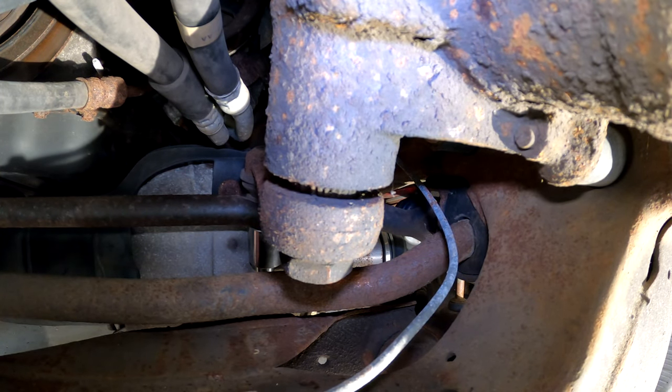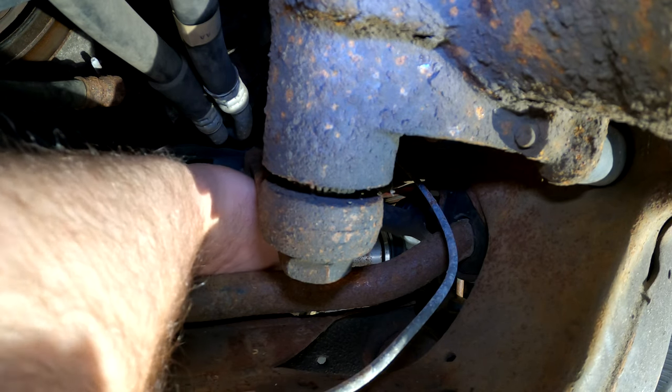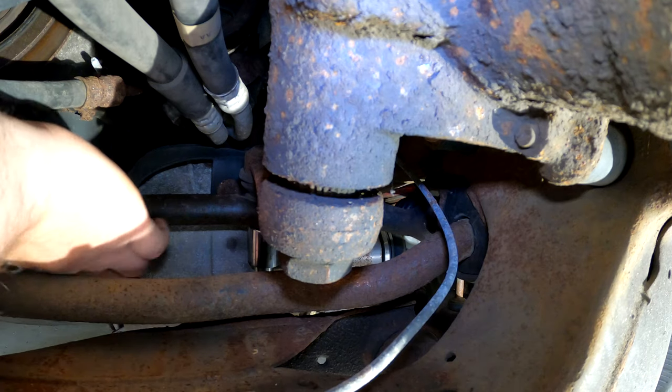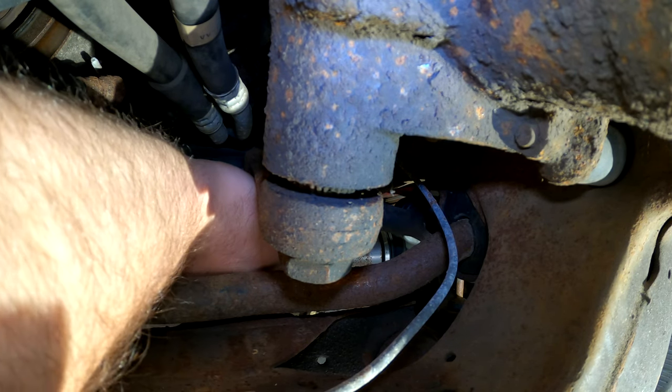If this is a four-wheel drive truck, your axle is here and you come through up here at an angle. This is why we dropped the idler arm first — because it allows this bar to turn and you can get on it at an angle. Otherwise you've got to fight with it. Little trick: if you turn your wheel slightly to the right, you get a lot more clearance on this side. I was trying to figure out how to get the puller up there to break the connection between the center link and the pitman arm, and none of the tools in the OTC kit were going to fit. So I had to think about this — turning the wheel to the right gives you a lot more clearance.